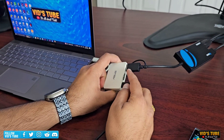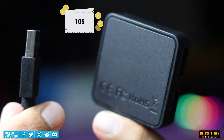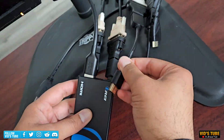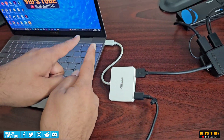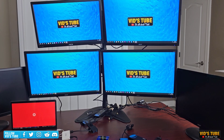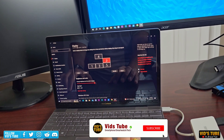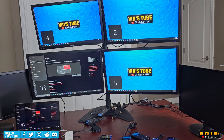In order to connect more monitors with the other three Ori Split Extends, I need more USB Type-A or Type-C ports. I had this adapter from Amazon for just $10 that converts one USB 3.0 port to four USB 3.0 ports. That is how I can connect more of these dongles. So let's connect four monitors via two Ori Split Extends — and voila, now I have a four extended monitor setup. You can go into display settings and rearrange the display placement, which is crucial for a fluid workflow.